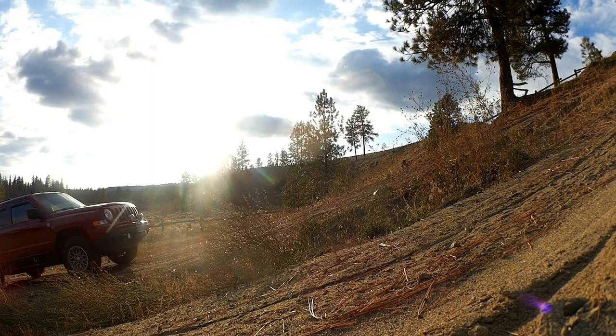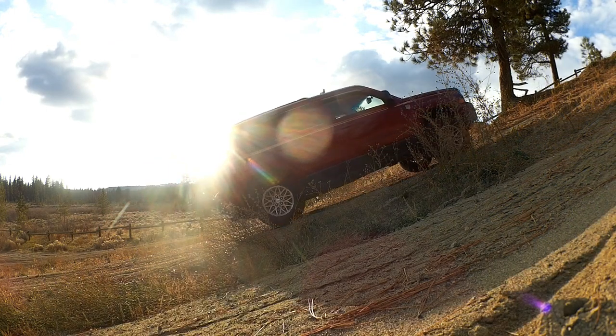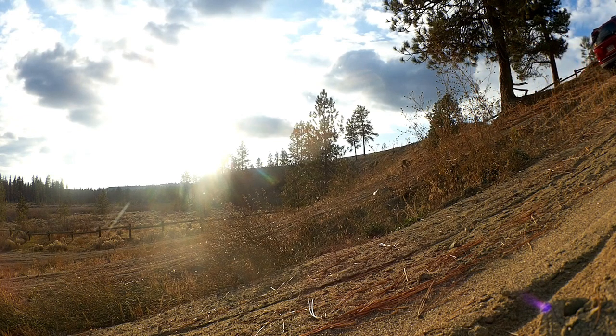That's not a lot of torque at the wheels. And the reason it matters here is that the larger the tire you have, the worse mechanical advantage your engine has against the ground. With small tires you might climb something steep because you have great gearing advantage. With a larger diameter tire, you don't have nearly as much gearing advantage. On a car with a low-range transfer case, you'd have a lot more gearing available to you.